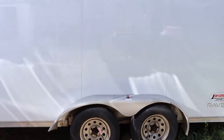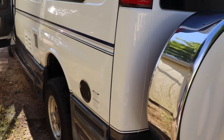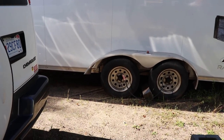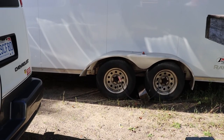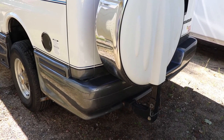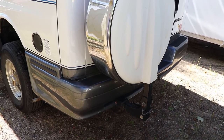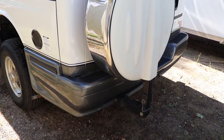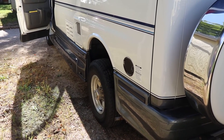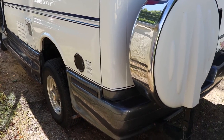If you have an enclosed trailer like this with interior lighting you could forget the lighting on and there's no protection on this vehicle for turning anything off - you could kill the battery pretty quickly. So your auxiliary power is best to come off the coach battery. On my Jeep Grand Cherokee it had a whole separate set of fuses for the trailer, so if you had a trailer fault and one of the wires shorted out you'd only lose that on the trailer and not on the tow vehicle. This vehicle has the stop lamp switch pre-wired, so there are different approaches.